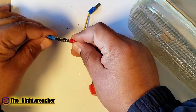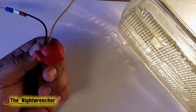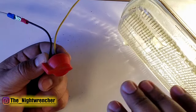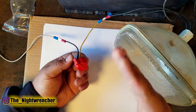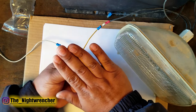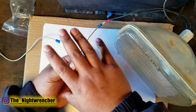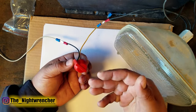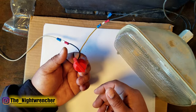Let's go ahead and wire up the rotary switch and demonstrate how it works. I've got it wired up — just like the toggle switch, as long as it's turned to the on position the headlight is going to stay on. There are really two reasons why you'd pick one switch over the other. The first is fitment — if you don't have enough room or don't want something sticking out, a rotary style switch is probably what you'd want. If you don't have easy access to turn it, go with a toggle switch. The last reason is just aesthetics — use whichever style you prefer.